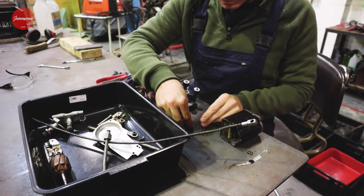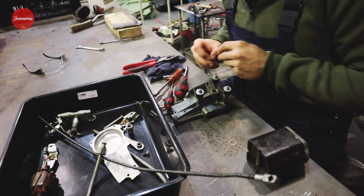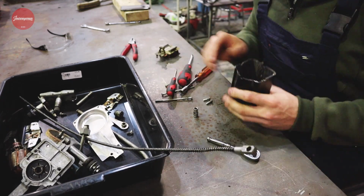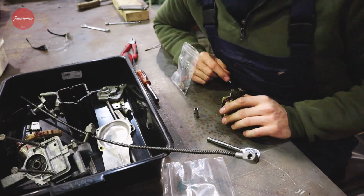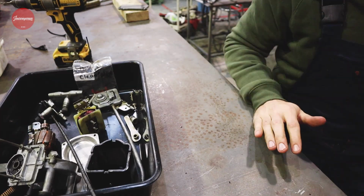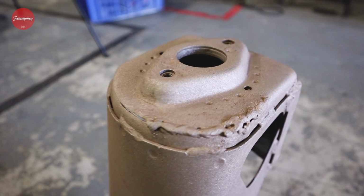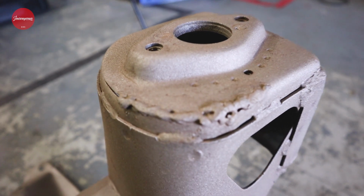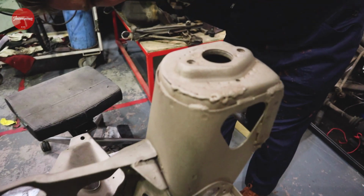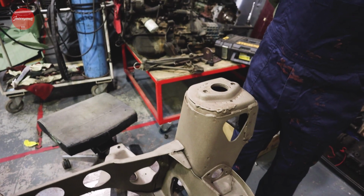After the workbench had been sorted out, Graham moved on to the strip down of the wiper motor. All the bits and pieces will be cleaned and plated before we put it back together, and it was then time for us to take a look at the cracks in the subframe. You can see the cracks formed all the way around here, and basically we're going to try to TIG it up because that means the least material removal after the weld. And our plan is to grind back all the welds and then try and pull that crack as close as possible.